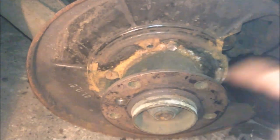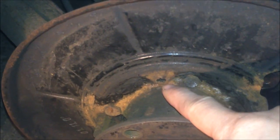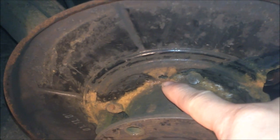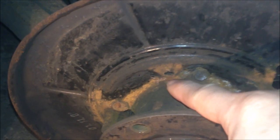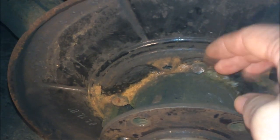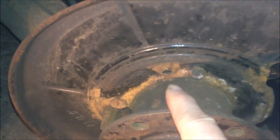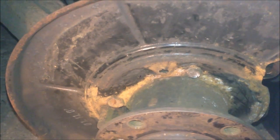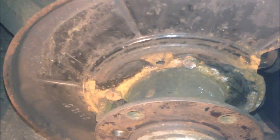I opened this rear left brake and found that the back plate or guard plate — the pinhole for the brake shoe's holding pin — is broken. It's enlarged and rusted. So the shoes came off from the back plate, and the pin and the spring just got stuck somewhere, making grinding and strange noises from the brake.